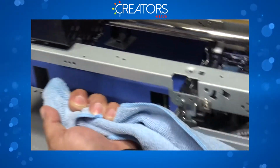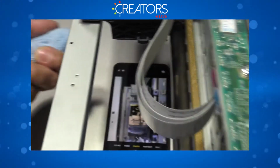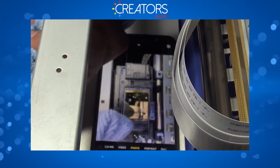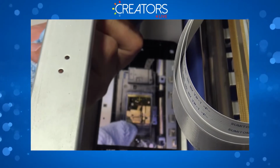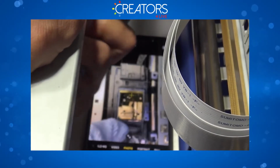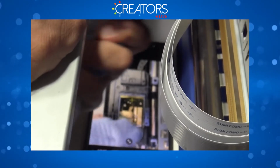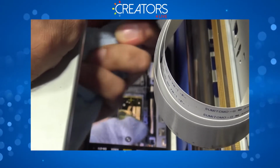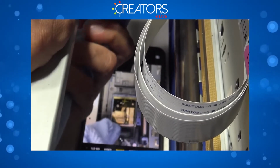So very carefully, you're going to bring your finger. If you want to go ahead and step over here, so you can take a shot from this angle. What you want to do is very carefully place your finger right there. You also want to bring your head down to make sure that you're not touching the mirror plate. You're going to hold the carriage, and now you're going to scrub rear to front a lot. Again, when you're doing this, be very careful and do not touch the mirror plate.